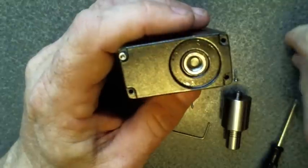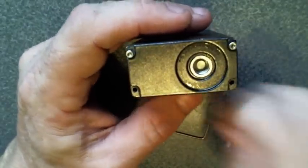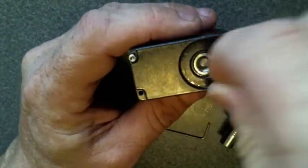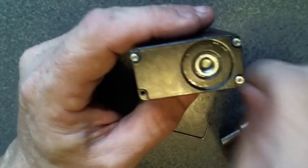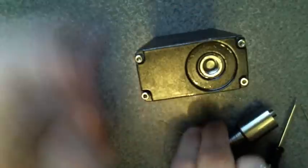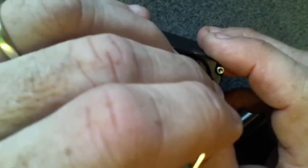Like I said though, if you are getting that weird atomizer no link, I wish I had it. I wish it was loose right now. I could show you what it does. And then your ohm readings will just go all over the place. Just remember, it's that simple of a fix. It's really not that bad. The main thing is making sure you have tape on those buttons so they don't fall in. And once you get that, you should be good to go.